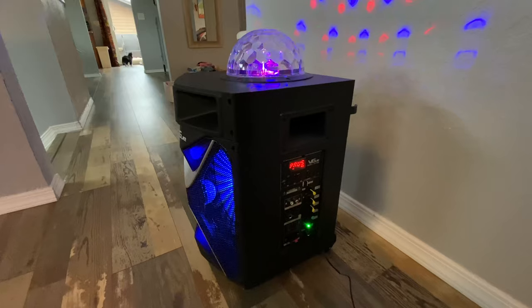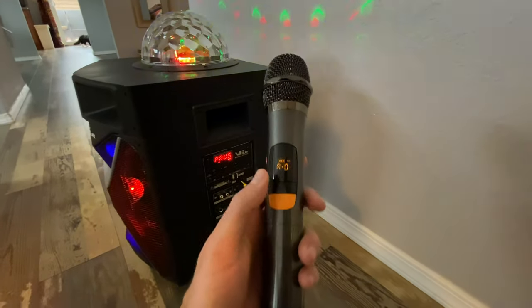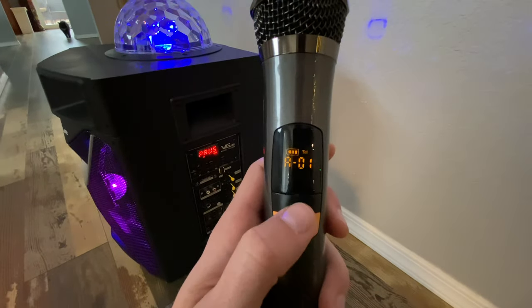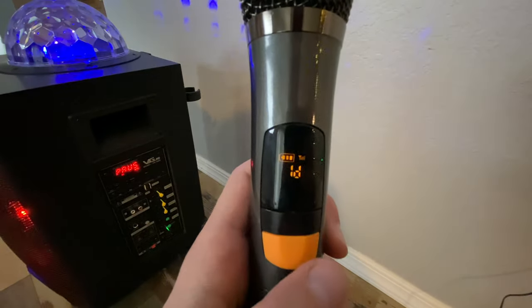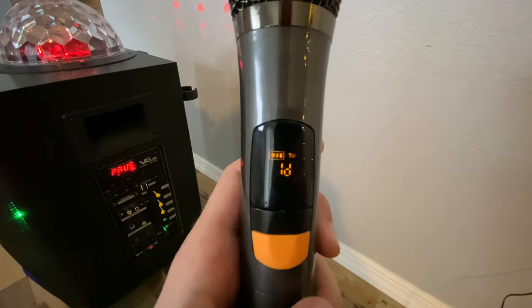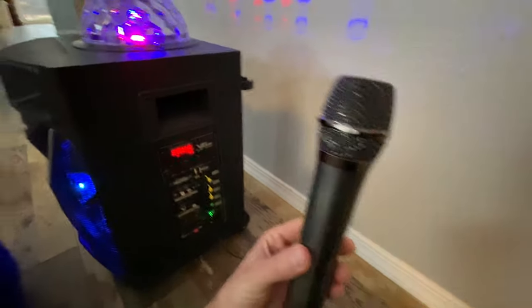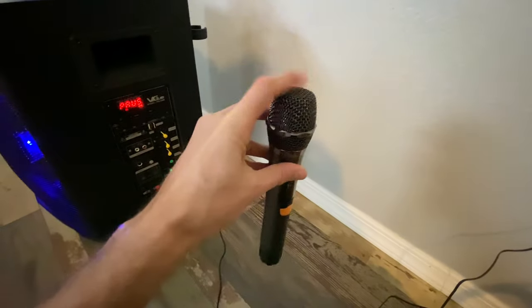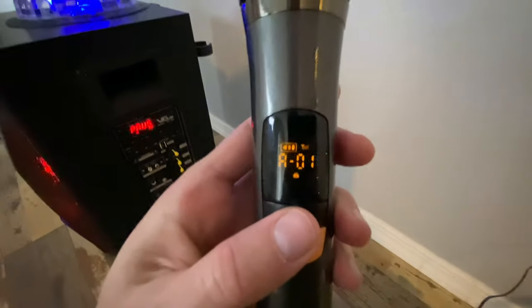One thing to keep in mind is the microphones. If you give these microphones to a kid, they're going to see the buttons on the side and start playing with them. The number one tip I have for people is if you're having difficulty pairing this microphone with the actual unit, don't try just the top button or the bottom one. The manual says to click those buttons, but the handheld piece may be on lock, so try holding down both buttons at the same time. That will unlock the microphone, kick it into pairing mode, and they should pair just fine.